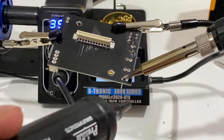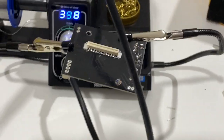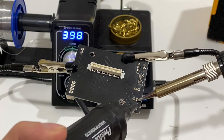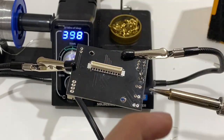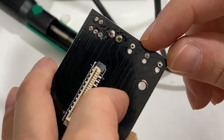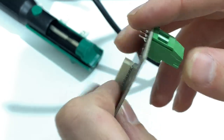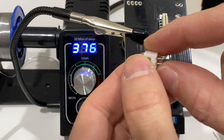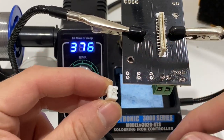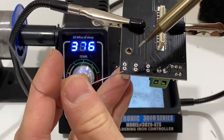Let's start from this one. That one is open. The focus is going in and out because of the soldering gun and pump, but I'll try to make it better. As you can see, I've removed all the solder from these holes. Now we are going to put the new sockets and solder them back in. The orientation is important — the opening slot faces this way. Plug them in like this and solder them in place.